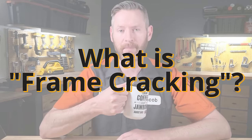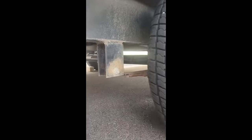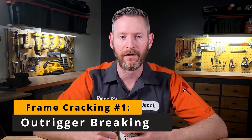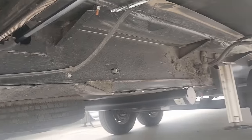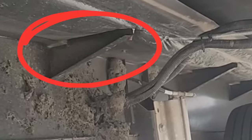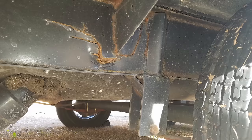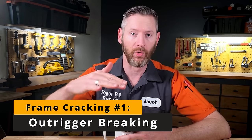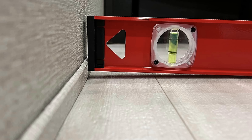So what exactly is frame cracking? Frame cracking is generally most common right around the axle attachment points for your RV. I generally see this happening in three different ways. One is related to something called outriggers — little triangular pieces of metal attached to the frame to hold up the walls. I've seen instances of these outriggers collapsing or even ripping off the frame. When outriggers start to collapse, you can see the flooring inside your RV buckling as the wall sags down because it's no longer supported.